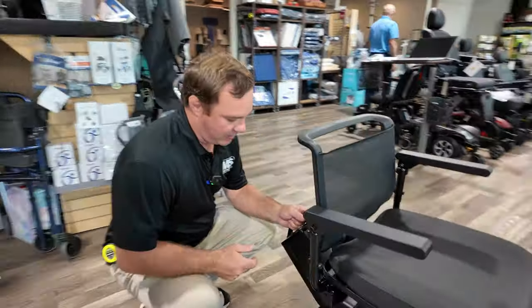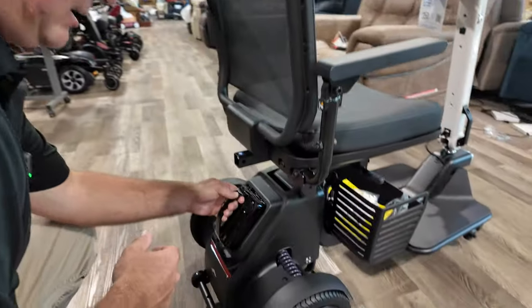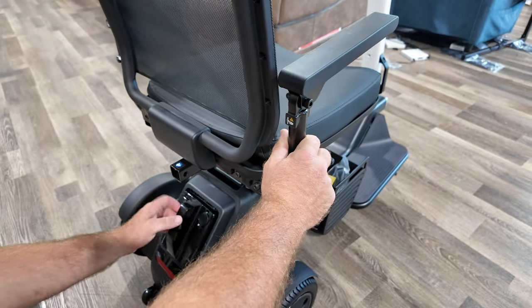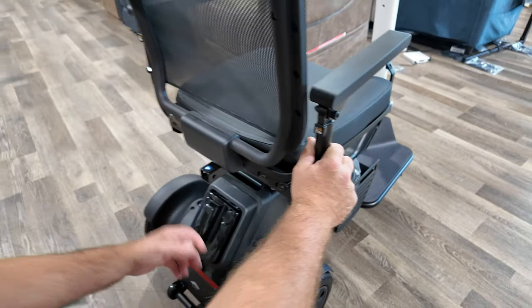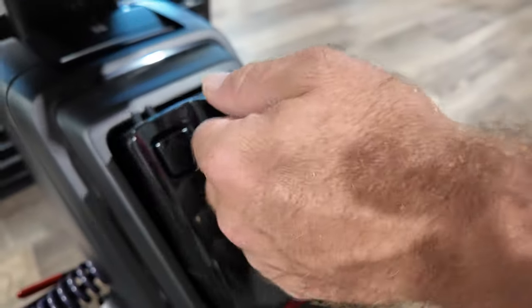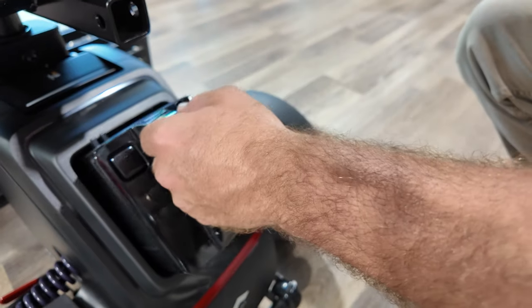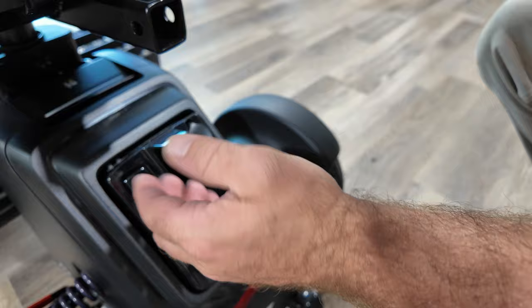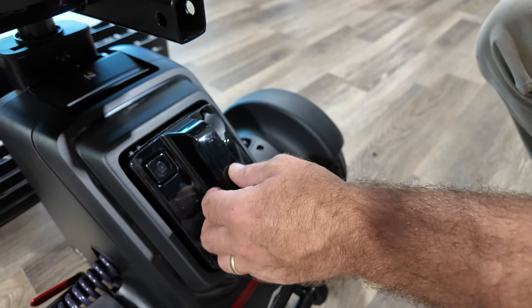It's a very lightweight battery. It just slides right back in there, and push it to take it out and press that button. You're not going to ride this for a while, so make sure you fully charge it up. That's where you charge it through. Leave it out on your seat so it won't discharge the battery. This battery will last a long time without being charged if you don't keep it connected, but we suggest charging it up maybe once a month.